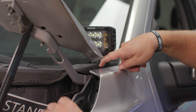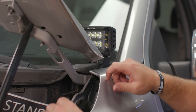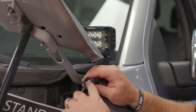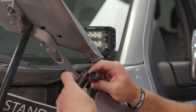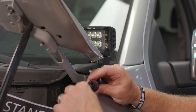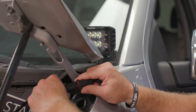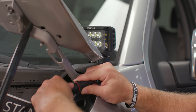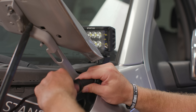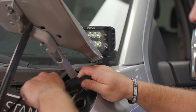We've routed the wire under the light and then just under this plastic trim piece and right where it comes into the hood. You'll notice the notch here on our IP68 fully weatherproof connector — just line that up with the opening and connect it, push all the way in, then bring our lock ring collar around. This is going to fully seal the harness against the elements for a fully secure connection.